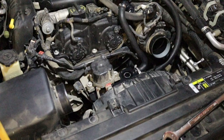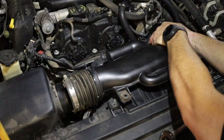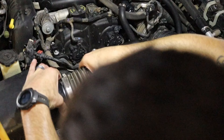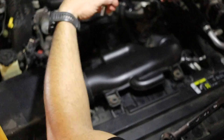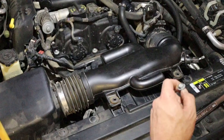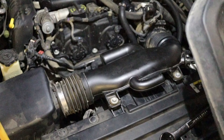Once you've completed that step, you're essentially done with your install. Now you just have to reassemble all your factory components, starting with your intake. Tighten up your worm gears using your number eight. Then reattach your intake using your number 10 bolts. And finally, reattach your dust cover.